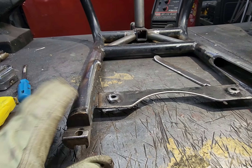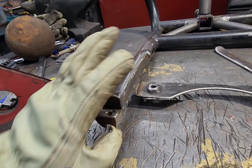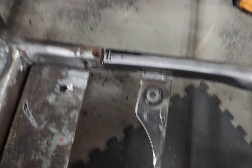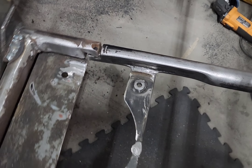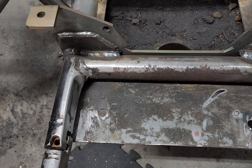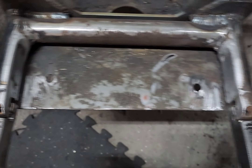It should be strong enough — this hitch is not going to hold anything crazy, so I don't think I'm going to be losing too much strength by doing that. I just wanted more clearance for the motor, so that's why I'm doing it. I've got the frame rails clearanced out for the engine now, and you can see it took about a half an inch out of the pipe off the one that comes out of the frame horn tube. Now I've got clearance for the motor, and everything's lined up good.